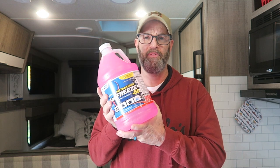Okay, so once you have all the lines blown out and you've drained all the water, there's only one final thing that's recommended. Pour a little RV antifreeze down the drain of each water source. So in the sink, a little down the drain. In the toilet, a little down the drain. In the shower, a little down the drain. In the bathroom, a little down the drain in the sink.